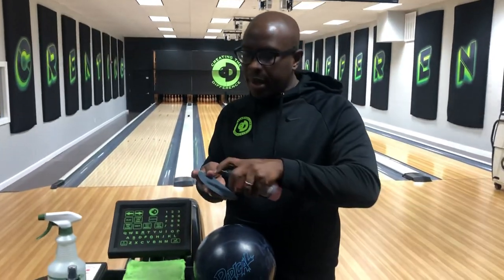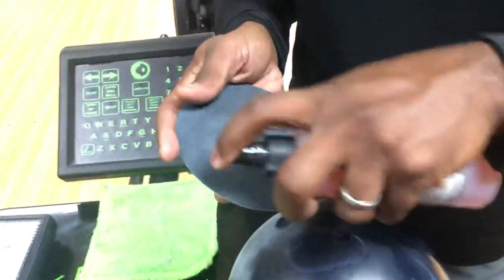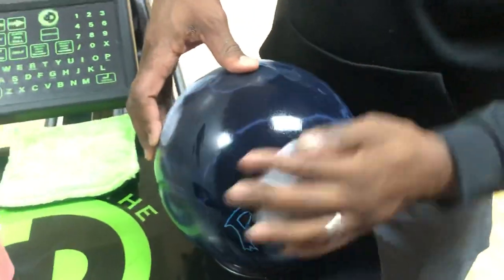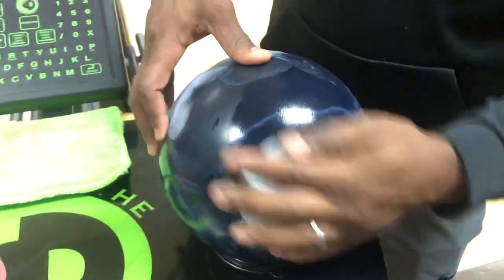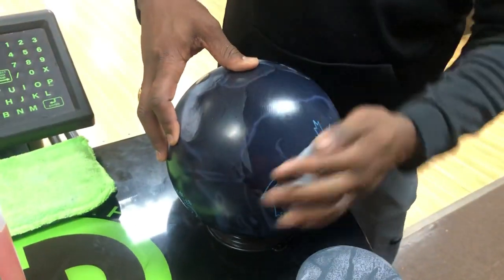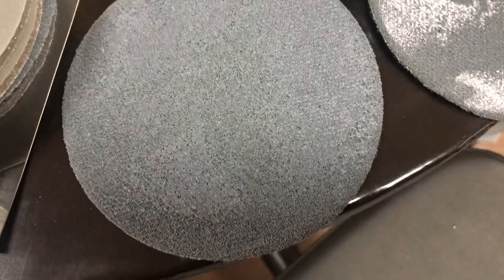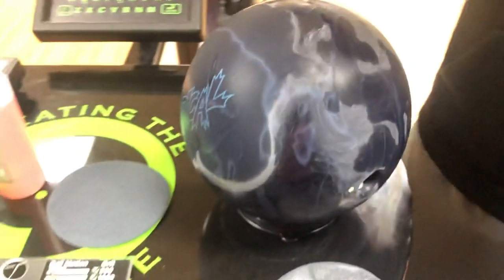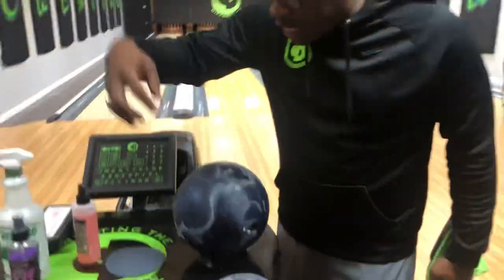Now I'm going to show you TruCut Conditioner. We're going to do the same kind of process — spray the pad nice and wet, get a new section of the ball, and start sanding. This product is made to extend the life of the sanding pad, cut down on debris, and give you a really consistent, nice even finish. You can see it doesn't appear that there's a whole lot of dust — the dust is going into the pad, which is what we want. Look at the ball: you can see the water side compared to the conditioner side. The conditioner allows the dirt to either go into the pad or stay concentrated on the ball.